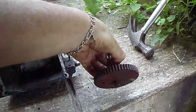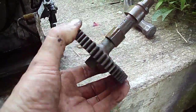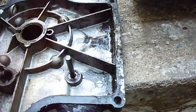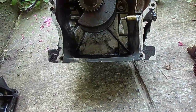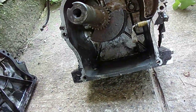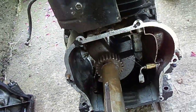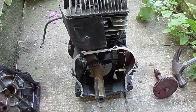I think he was right, because if you see the camshaft it's all rusty - more rust on the back there. I think she was right full of water and it froze up and broke it. Even if you look down the crankcase cover it's bowed downwards, so I think we got a freeze victim here. It wouldn't be good for much more than a Franken-Briggs engine at this point. I wouldn't really trust that broken crankcase unless someone aluminum welded it up.